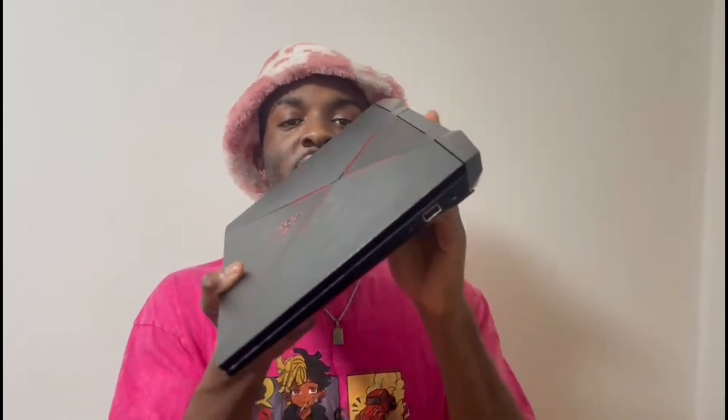The fourth tip is laptop positioning. You can't just put your laptop flat on a table — heat gets trapped and your fps will drop. Even propping it vertically is better, but in my opinion, use a laptop cooling fan. It blows cool air into your laptop and keeps temperatures down. There have been many times I've played for 20-30 minutes and my fps just drops — I touch my laptop and it's hot, and I realize the cooling fan wasn't turned on. The laptop fan is really key.